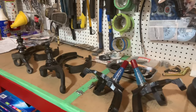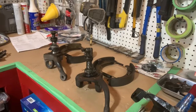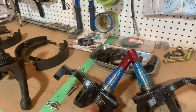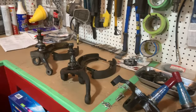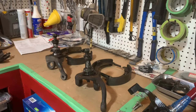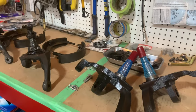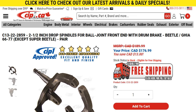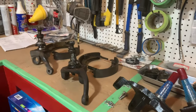By this point in my life, I should really know that projects never go as planned, and that your project car is never ready to drive by the weekend. As it turns out, the inner and outer bearings and seals for the stock spindles on my '66 Beetle will not fit onto the two and a half inch drop spindles I bought. It turns out the '68 and up Beetles use a beefier shaft, and the bearings will not fit on. Also, the tie rod tapers are smaller on the old ones than on the new ones. I missed that when ordering, but looking back at the website it does specify that. I've since ordered new tie rods and bearings, so that delays things a little further — looks like I'm waiting about another week before I can drive this car again.